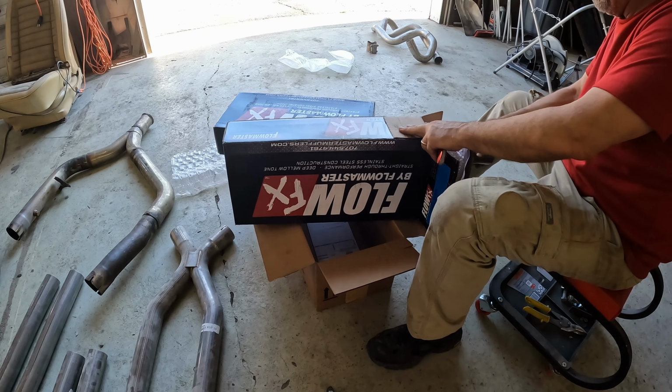Let me get my muffler kind of where it needs to be. I know I've still got a little bit of room here. I can still trim back here, which I know I needed to do, but I wanted to get this pipe cut and angled properly first. And I'm going to clear my coil over, so I'm okay there. And actually, this thing can rotate a little bit that way. It gives me a little bit better clearance. So we're looking good.